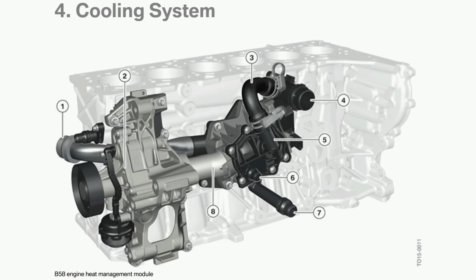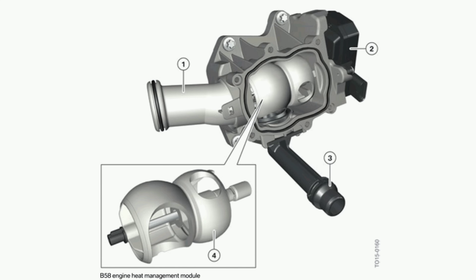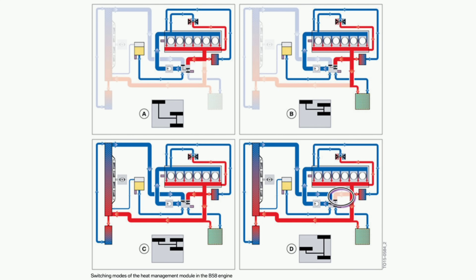A lot of those heat exchangers help the coolant warm up the engine oil and transmission fluid so they get up to temperature more quickly as well. Not only do they keep temperatures cool, they also make sure everything gets up to temp quickly so it's as efficient as possible — a win-win. It helps with emissions, fuel economy, and also helps us make more power safely. We also have the heat management module, which completely replaces the old-school thermostat setup. It can send coolant to any specific combination of components based on what you're doing — when you floor it, it optimizes for power; when you're cruising, it optimizes for efficiency. There are multiple ways the heat management module can direct coolant flow, which is why you can get good gas mileage in an engine that can make 600-plus horsepower.